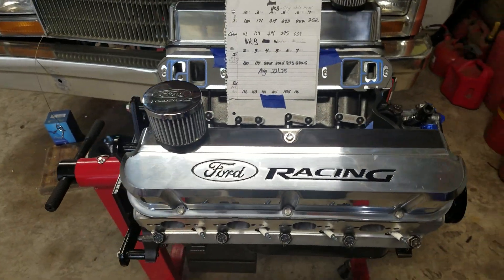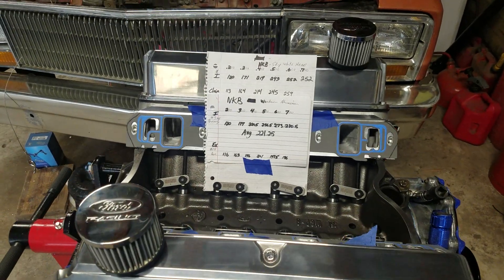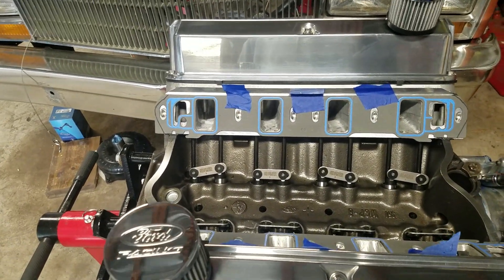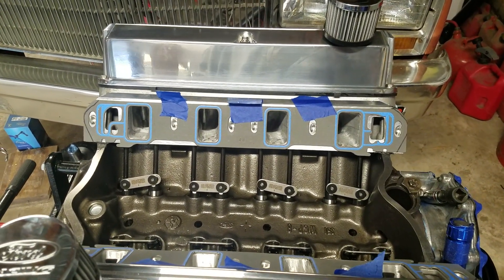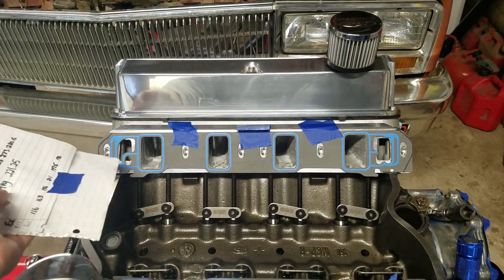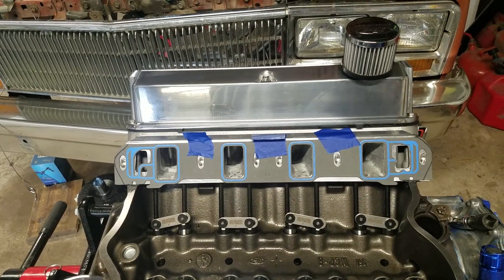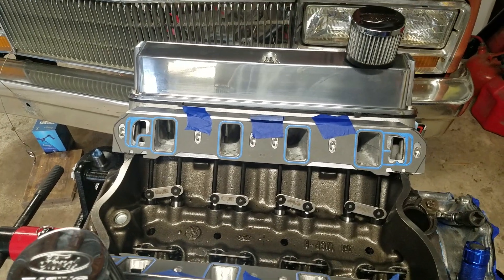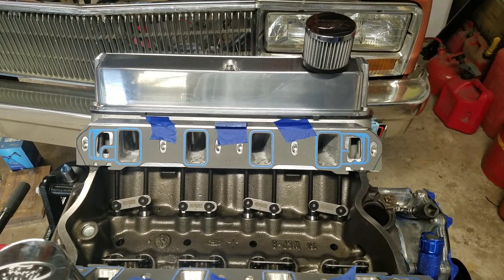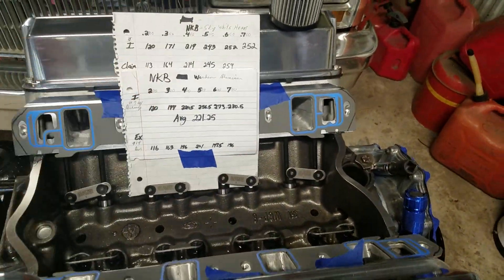There's a lot of things that I did to this engine that I didn't do videos on — there's just so many things to cover. Anyway, we're here to talk flow numbers. About these heads: now that I've done a lot of work with them, I'm going to say that some of the shapes could have been cast a little differently. But for what they are and the price point, it's really pretty decent. Out of the box this is going to be better than a GT40X, or comparable to an Iron Eagle 200 or a Blueprint aluminum small block Chevy head — and actually cheaper than that.